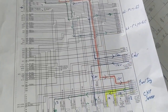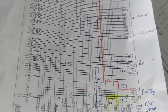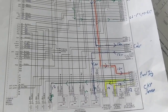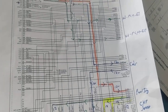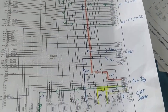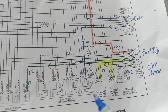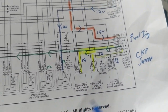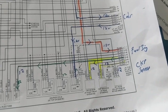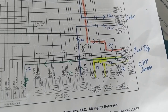When we always talk about schematics, let's say we're looking for something. We put a scanner and we get a code for a crankshaft sensor or camshaft sensor. We go to the schematic itself and we come across many sensors. We come across CKP or CMP. We're not sure if that's the right one — the scanner gave us a code. We have a crank and no start.